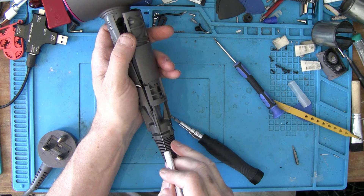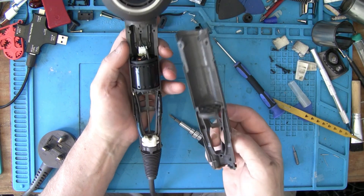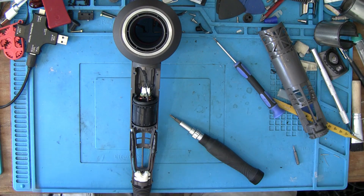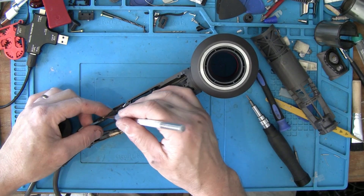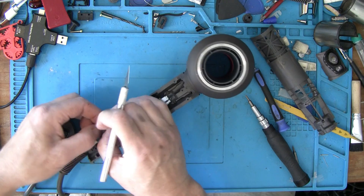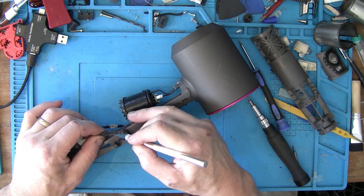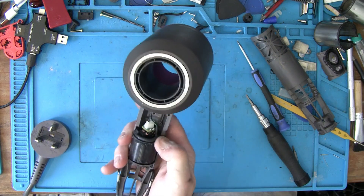Just need to cut off your seal - go around there, it's only a little bit of fabric material. I'm going to take this off and take the heat shrink off from your cable - I am unplugged. That way I can just probe it: I can plug it in and probe it and just see if power is getting to the actual hair dryer itself, or if it's an actual cable problem.